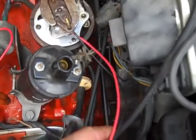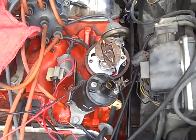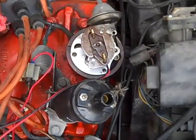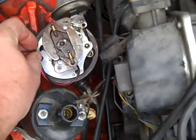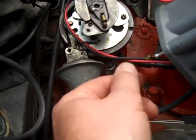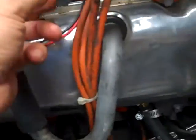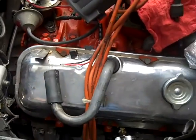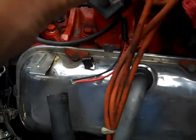It's mounted, but my wires are shooting out on this side. My distributor cap hole is right here where the wires want to shoot out — they're going to shoot out over here, so I'll have to sort that. I certainly don't want these wires getting into the rotor cap. I did just a little wire tie like that, and the wires can be pulled through but it'll keep them from coming up into the rotor cap. I'm going to put a little plastic protection here as my wires shoot out the hole.